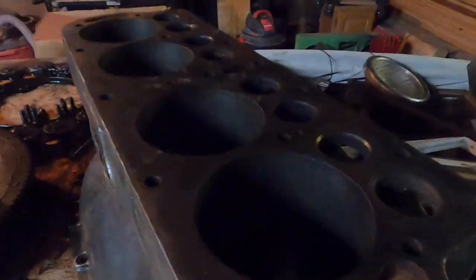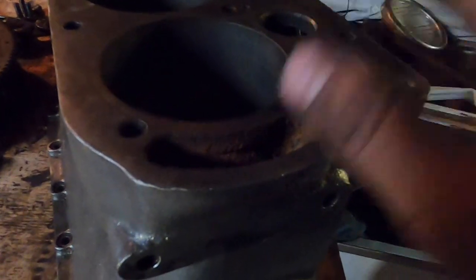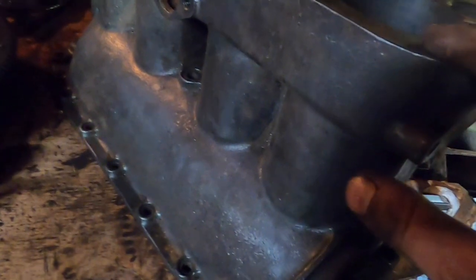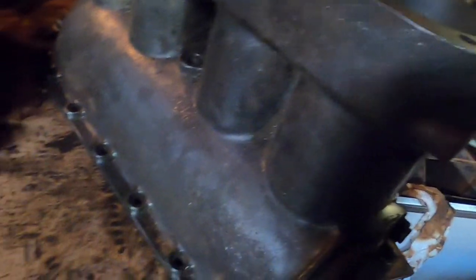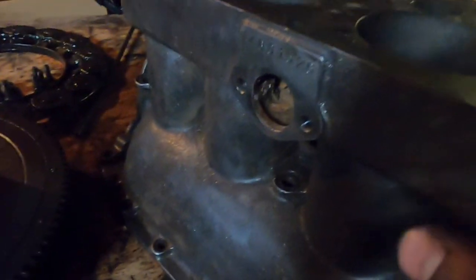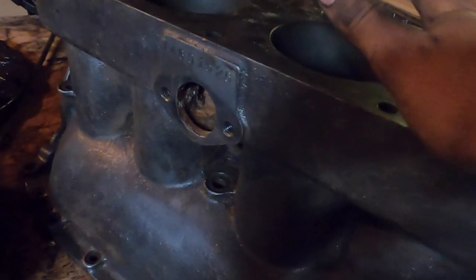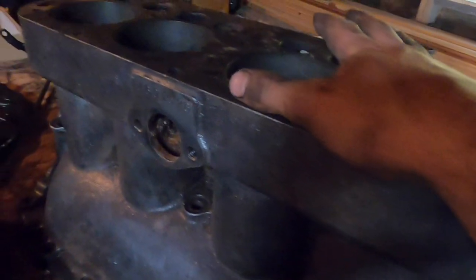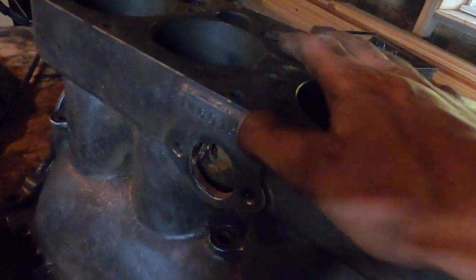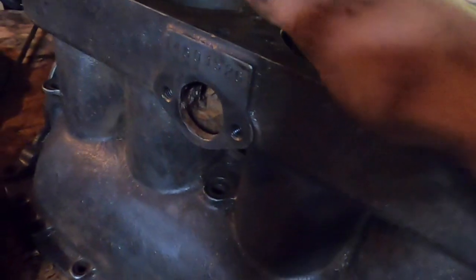They built 15 million of these engines that specifically went into cars, and then they kept building them at a much lower production for some years after into the early 40s. Just for replacement engines and marine applications and some other things. So in total, they built like 15 and a quarter million, something like that, of these engines. This number is 14,600,000 some. So I thought that was kind of cool. I dated this number. It dated that to mid-December of 1926 when this engine was made, and then the car would have been assembled shortly thereafter. So that puts the car as a very early 1927 model.